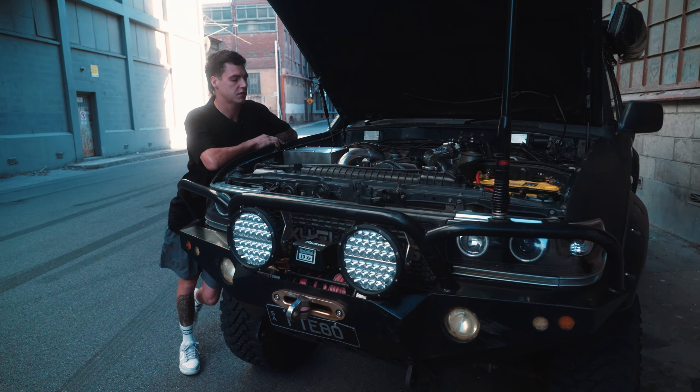When we did the engine, we fitted a front mount intercooler which is PDI, and it's got a G-Turbo red wheel on it, the AXIS fabrication air box and snorkel. Down the back is an NPC billet flywheel paired with a CD heavy-duty clutch. Uni-Mick did all the wiring loom, and then Glyn Grudge put a custom tune in it with a uni-chip with a 5-max selector. It's pretty nice — it's where I want it to be now and I couldn't be happier with it.